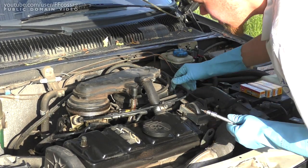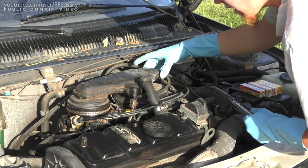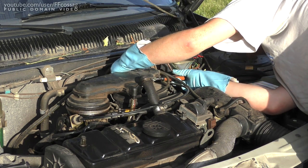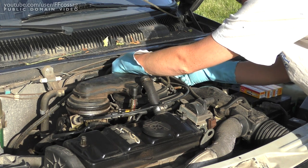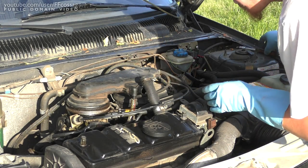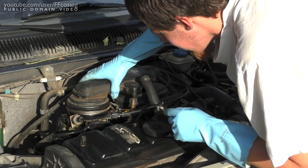These engines also have a bit of a design flaw - in fact there's actually no gasket between the air filter and this clamping thing, as you can see it's just entirely loose there. You can optionally add a hose clamp, as these people have done, but from the factory this whole thing is just placed on top of the air filter with nothing in between. I'm thinking that has probably caused a premature death for many of these engines.